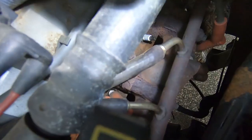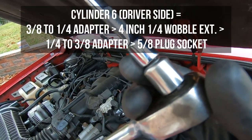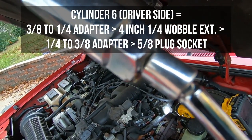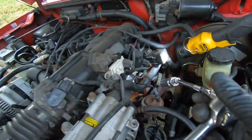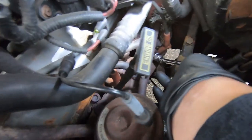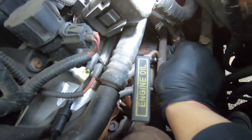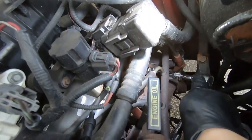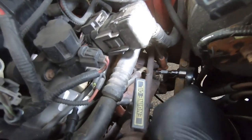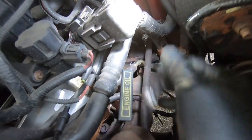Now let's get that plug out. There is our plug. The setup I'm going to be using: a 3/8 drive socket wrench, 3/8 to 1/4 adapter, 1/4 four inch wobble extension to a 3/8 adapter back to our spark plug socket. I'm actually going to go under the EGR pipe on this one. Going to get this wobble to cooperate and get that on the plug. As you can see I'm under the pipe — I got it, and yes it is coming out.